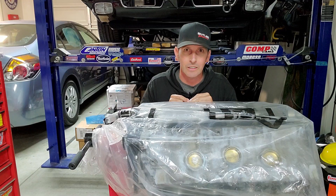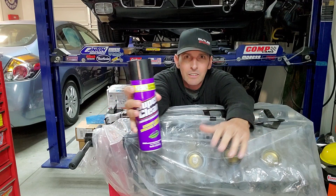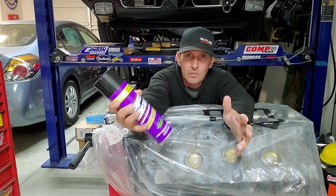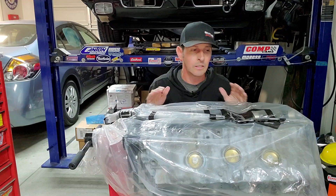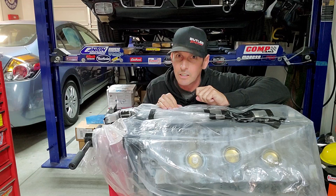If you don't have this foam cleaner — which I really liked; the way it expands you can tell it gets everywhere, and I only had to do it twice with no residue — you can use dish soap and hot water, you just have to do it a couple extra times. Proof the cleaner worked: the rust was already flashing, meaning there was no oil coating left inside the block. I love it. Now we can make some progress and get some color on the block, but we don't have time for the painting process in this video — that's going to be the next video. Thanks for sticking around, subscribe if you haven't, it's going to be fun. Until next time: build them fast, drive them faster!